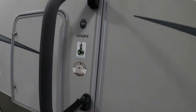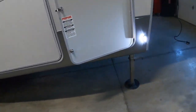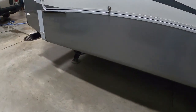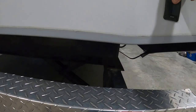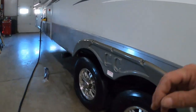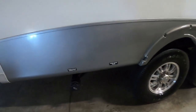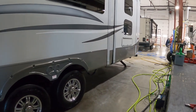Exit the unit. Lift and turn this handle. You'll want to go in there to check the level of your tanks as we're dumping. If we've been dry camping, head to the rear and bring up the stabilizing jacks — hit retract and make sure they're all the way up. Come to the front, dump your fresh water drain, and head to the nearest dump station. If we're at a campsite, unhook power, water, and cable, then bring up the stabilizing jacks and head to the dump station. Park accordingly — your dumps will be right in front of your tires on the driver's side.